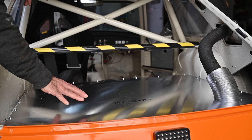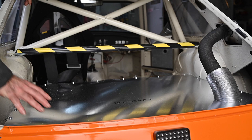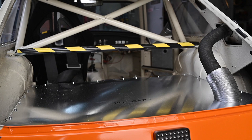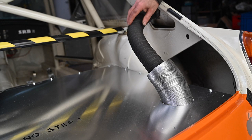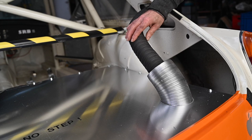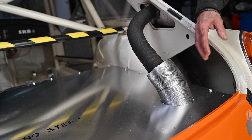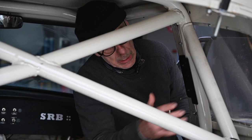I added a firewall to the back of the car because underneath the car we have the gas tank, so this is going to give me some extra protection. It has been sealed in and locked down. You can actually see the hose of the filler neck coming in on the side — this is the filling hose going to the cap, and it's a special fuel hose. I also fitted it through the firewall in another protective flexible pipe so it has plenty of play inside and it's not going to wear through.